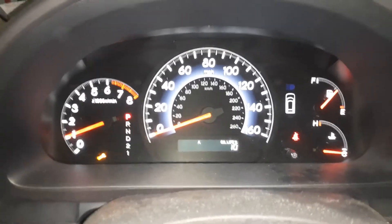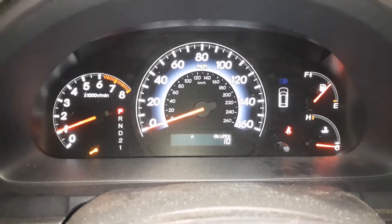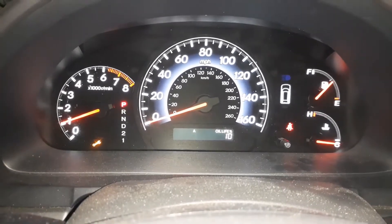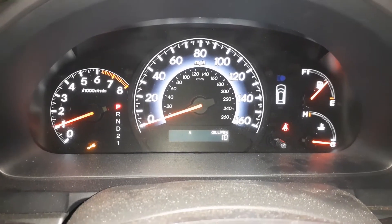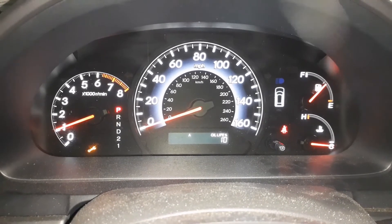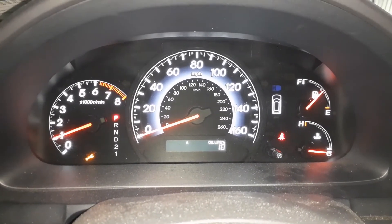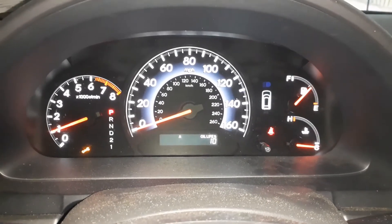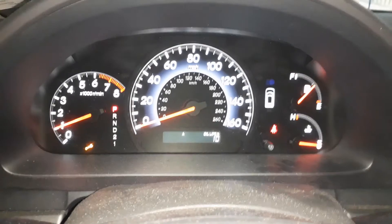I'm going to start the engine now and see if that fixed it. That looks to be good — the check engine light went off and it is running smooth. So that was the problem. If you have the P0344 and you're wondering what the issue is, it's the timing, and it probably popped up after your timing belt change. In that case you should look at and probably redo the timing belt alignment. Hope this helps, and if you like the video please click the thumbs up button and subscribe to my channel — I have other videos on this Honda Odyssey.